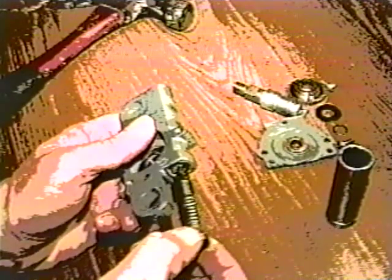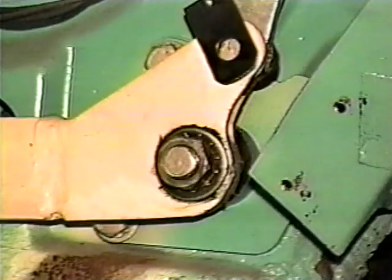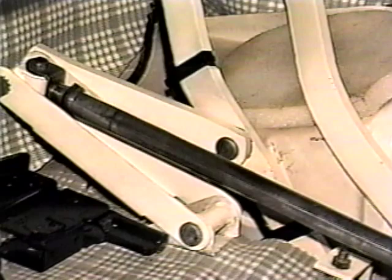If you have been through the adjustment procedures and you can't seem to get the top to line up with its locks properly, or the adjustments seem to keep changing on you, chances are the bushings in the control links, control link arms, rear power links, and power link arms are worn.